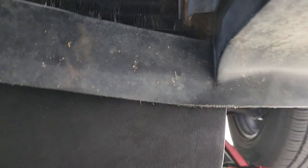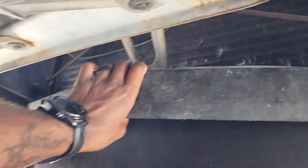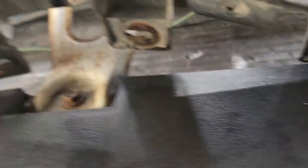What I'm gonna do — I might take it to a shop or I may do it myself, I don't know yet. I pretty much just cut this section of the airdam out on both sides to get rid of this. But I don't think for right now there's gonna be any problem with the airdam scooping air up into the radiator, because there are pretty much gaps with this pushed up out of the way, so air will still be able to flow through there regardless.